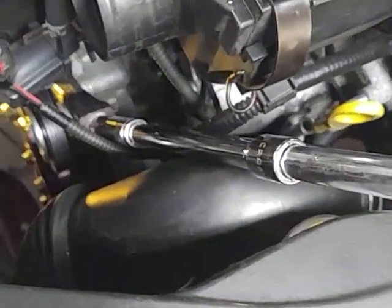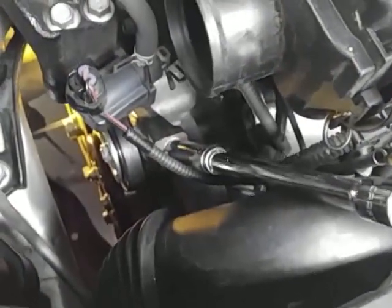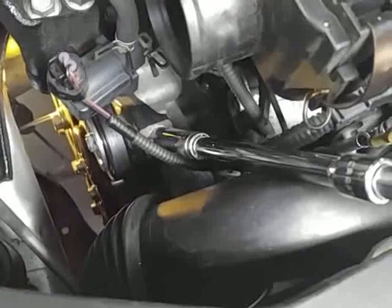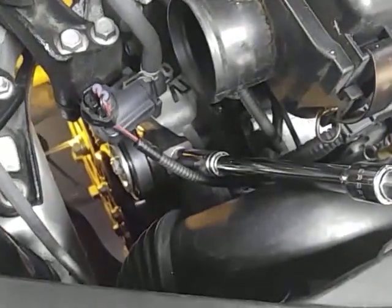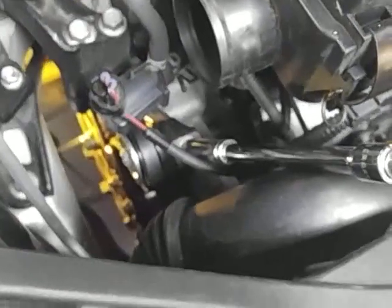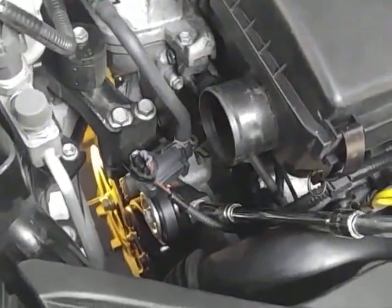And then you have to have a pretty long extension to get down there to be able to turn that. You need to tighten that thing where it's, I'd say, tight as a rubber band that you can just mash a tiny bit. It requires pressing down on it about 1/8 inch, and I don't know if there's any way you can measure that really. But I felt the old one before I took it off, and it was really tight. So I just put it back like the other one, and I'll run it a little bit, and I'll check on it again to make sure it's tight enough. But there you are. Not as easy as the other eBay people say it is.